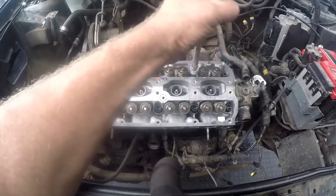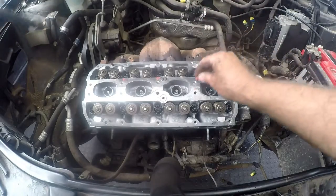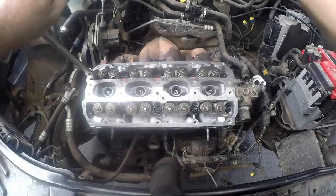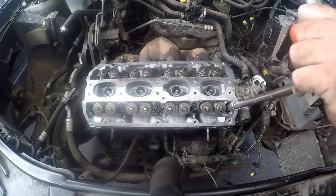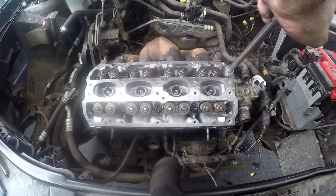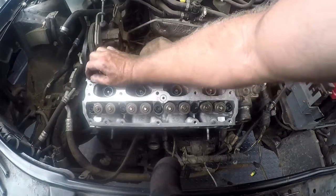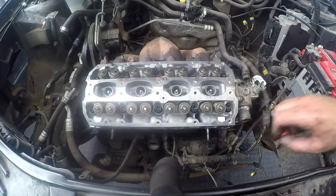Another 90 degrees here. Listen — I've been a mechanic for 30 years. The 90 degrees doesn't have to be very, very precise — it's a guide, it's a gauge. I'll get a lot of criticism from some people for that, but I'm a big boy, I can take that. So now we've torqued all 10 bolts with the first 90 degrees. We mark all the ones we have already torqued.